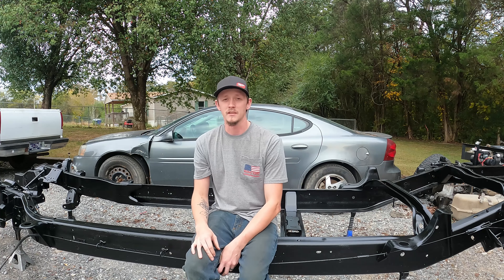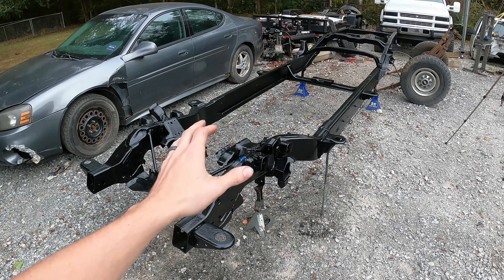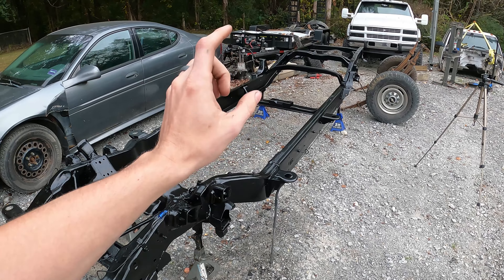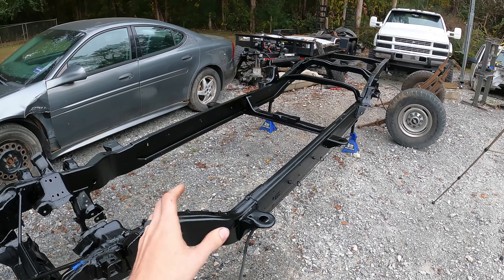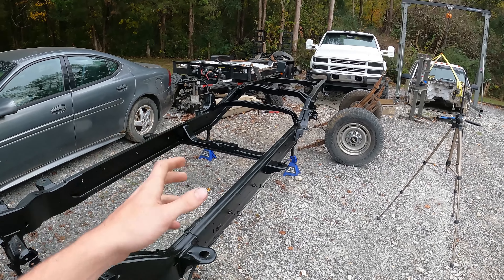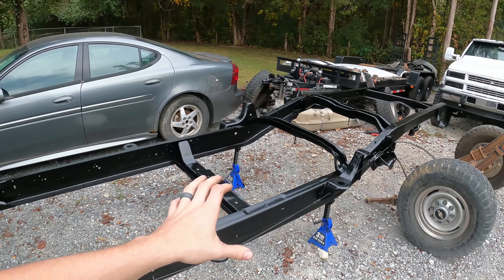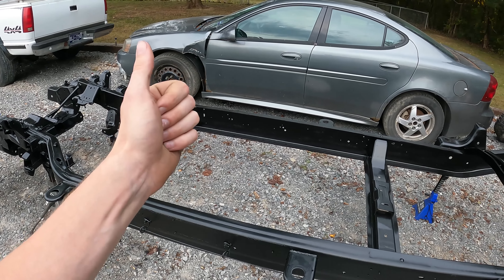Let's actually look at this frame and what I did. This frame had a bunch of surface rust on it but nothing that really ate into the metal at all. I'd bet this frame still has factory thickness — being in the south its entire life, it didn't see any road salt. It still honestly had factory paint and factory coating on it. I went at it with a wire wheel on my grinder and it showed factory paint, so I knew it was all just surface rust. There was really no pitting and no rot anywhere on the frame.